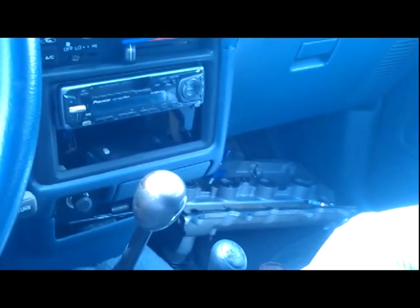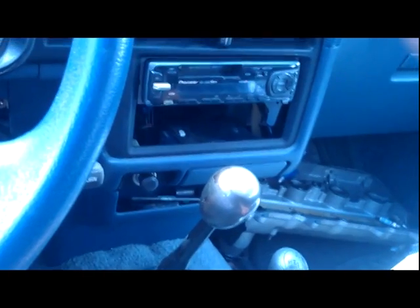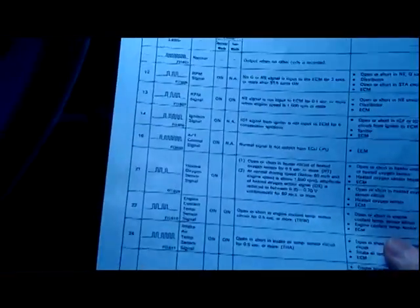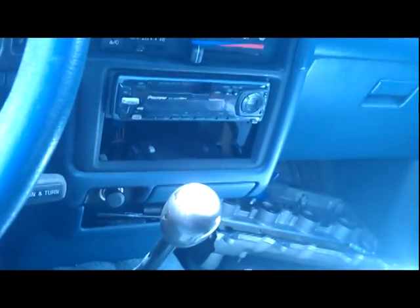So you wait about 20 seconds for your capacitor to discharge, leaving the fuse out. If you have a Honda, Mitsubishi, or Ford — Ford calls their computer a PCM — the fuse may be labeled differently. It might say EFI for electronic fuel injection, or ECM, or PCM. Look in your repair manual — not the owner's manual that comes with the car, but your repair manual. You can also find this information online on forums. Search for blink codes with CEL — CEL is short for 'check engine light,' it's how a lot of guys refer to it on forums.